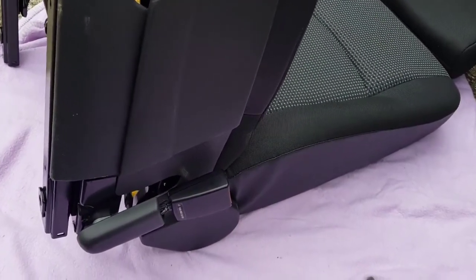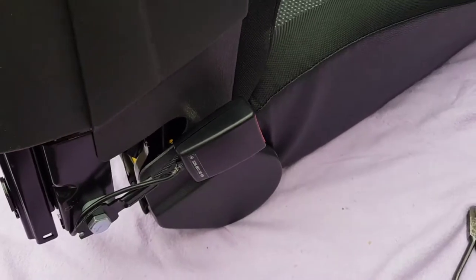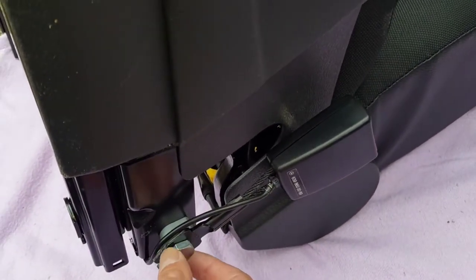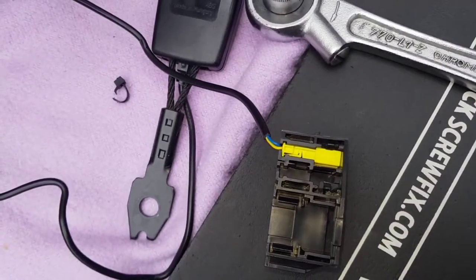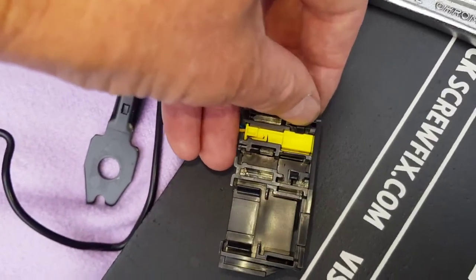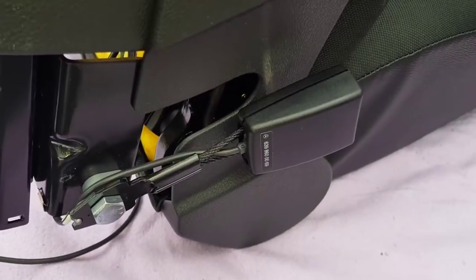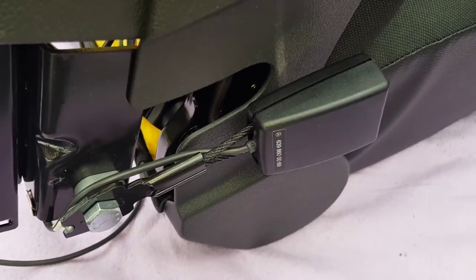The seat's out of the van now. Here's the buckle — you can see there's a plastic cover on here that just pulls off. The cable runs around through a little metal clip and up into the connection. The nut we need to undo is this one here — looks like it's probably about 17mm. To get the yellow connector out of the plastic clip assembly, you need to bend back this little bit here and then prise the yellow connector upwards. That's the new clip installed now — I just need to re-route the wire and hopefully that'll be it.